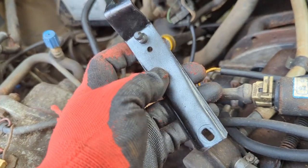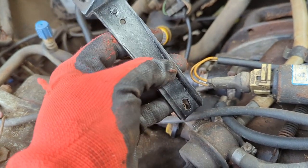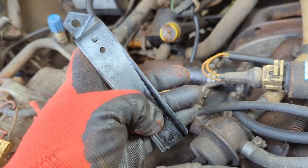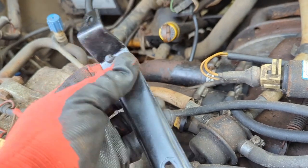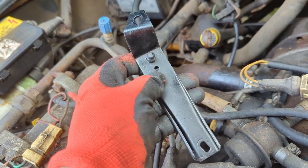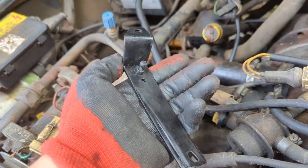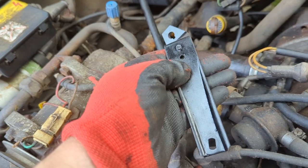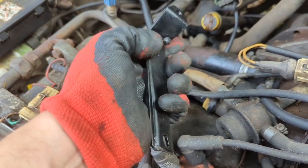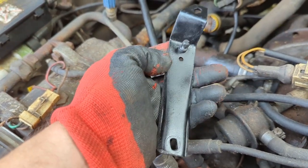One way to access it is to take out the bottom bolt — there's a big 15mm nut on the side of the transmission. Drop it down and you can get to some of this stuff a little bit easier when the lever is off the car. This is also one of those rare pieces you don't want to lose or let go bad, because there's no new source for it at the moment — it's a very specifically made part, for the Vanagon automatic only. If anybody wants to start remaking these, that would be great. That's it, guys — like, share, subscribe, and we'll see you in the next video.